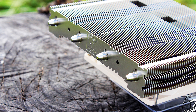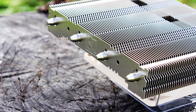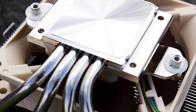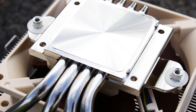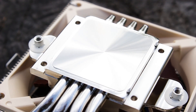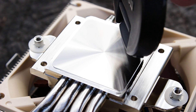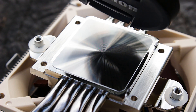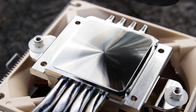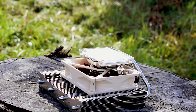As I've said in previous reviews, it is the little details that make a cooler great, and this is one of them. The base plate of the NH-L12 Ghost S1 is made from nickel-plated copper, just like the four heatpipes. The base itself has a smooth surface with a radial sunburst pattern etched into the top layer. These circular marks are left from the manufacturing process but they are so smooth that the evenness of the spread of the thermal compound will not be affected.